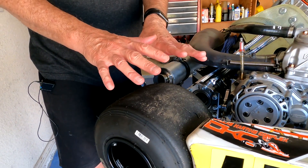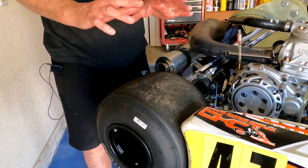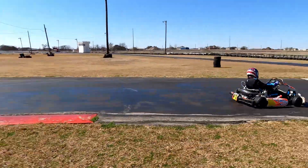When you go into a corner, the outside tire has to go faster than the inside tire — just physics. Since there's no differential to make up the difference between those two turn speeds, we trick the go-kart a little bit by raising the inside tire off the ground — maybe half an inch at most — for a very short period of time. That's what allows the cart to pivot and turn into the corner.